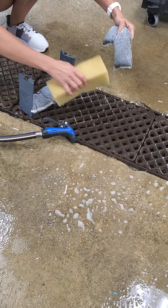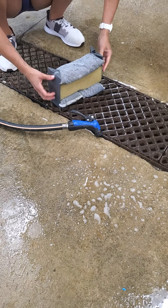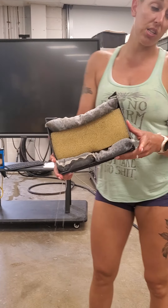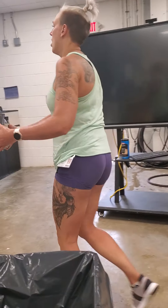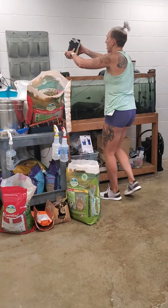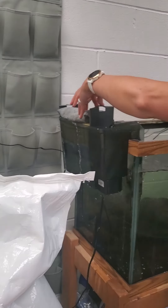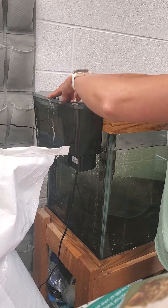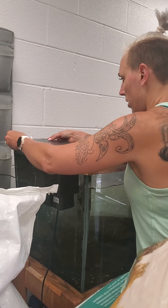You can see the water's running clear on that. So then it goes sponge next, and then this one on top. If you put the two little ones on top, the water pressure is too much and it'll actually float them out. Then this can go back in. You can do this cleaning procedure in a sink — it's just the hose has a little more pressure so it's a little bit faster. All you gotta do is stick these back in here, slowly and evenly press it down, and then stick the lid back on.